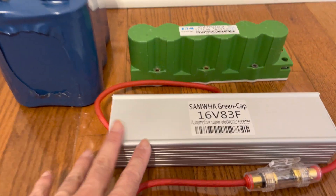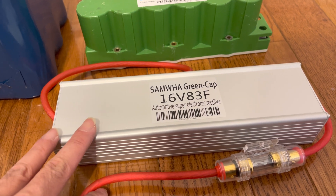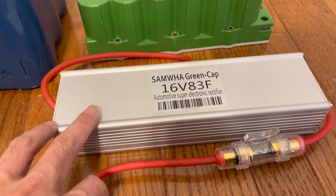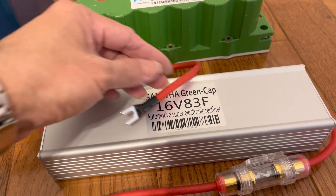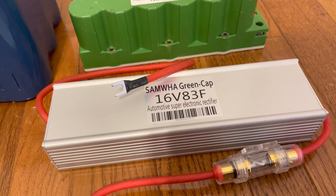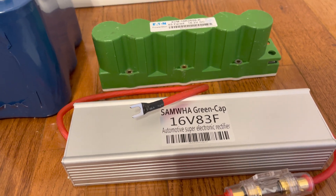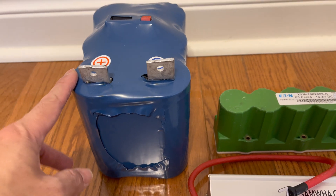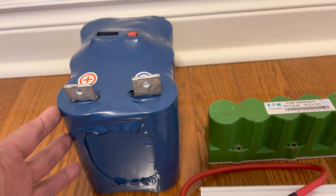This capacitor pack's maximum sustainable current is about 10 to 20 amps, but with a short burst of three seconds it can deliver 100 amps. It is able to do the job and work with a dead battery ranging from about 8 volts all the way up to 11 volts — a very weak battery. The biggest pack can even start the car by itself without any battery.